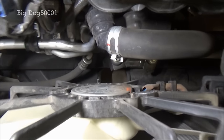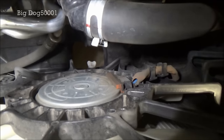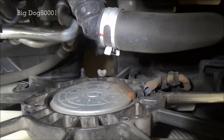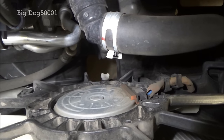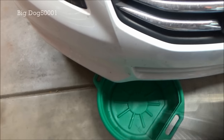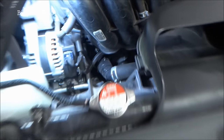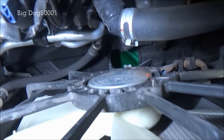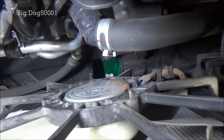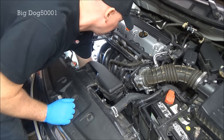From the front of the vehicle, looking right over the radiator cap, look down and that white thing right in the middle there — that is your drain for your radiator. We're just going to crack that open. Usually you can use your hand and just crack it right open and drain the radiator straight from that. Before we crack it open, we'll put our drain pan right under there, right in the middle, so our coolant will go right into the pan.